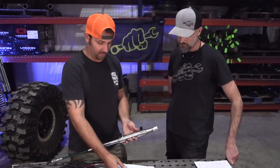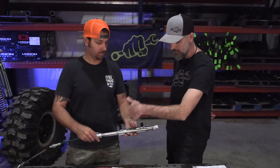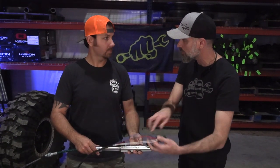If you turn the system on and it immediately goes to full lock in one direction, that's pretty easy to fix. The brain box thinks the sensors are in different spots, meaning you've got them plugged into the wrong connectors. Just switch your sensor plugs and that solves it every time.